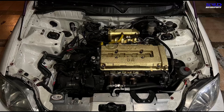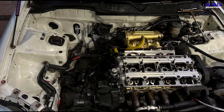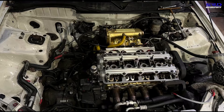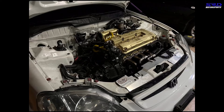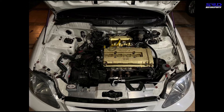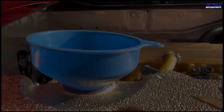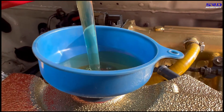Now we're setting the valve lash or valve tappets before the initial startup. With the valve cover removed, we pour about one liter of oil over the top to lubricate the camshafts, the lost motion assembly, and the rocker arm pads. Even though oil pressure will be good, everything is dry on initial startup. This applies to all newly built engines - D series, B series, H22, K series - you've got to lubricate everything before startup to preserve engine life.